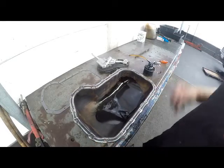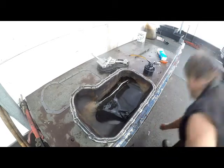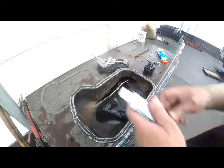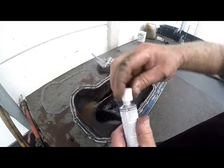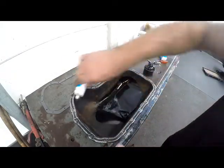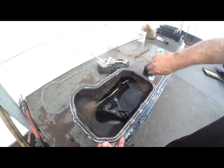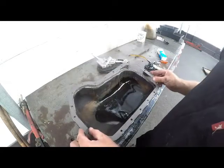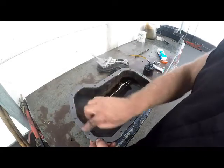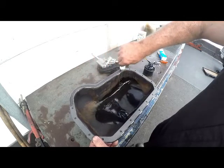We'll be putting on this sump gasket. What I do is use a good gasket maker — in this case I use Victor Reinz. It's a new tube, so we open it up and puncture the tube. We just put a nice bead of sealer on one side of the sump surface. It doesn't have to be thick because we are using a gasket as well — the sealer is just a precaution to give it a better seal. So we'll put the gasket on top of that, line the holes up as best we can, and then put another layer on this side of the gasket as well.